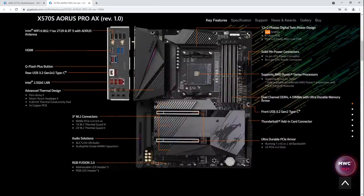Here we have the board. VRM upgrade — the old Pro AX. I think this happened on a previous revision already because I believe International Rectifier discontinued the IR3553 40-amp power stages a while ago. Anyway, this is now up to 60-amp power stages, so the VRM on this board is more powerful than it's ever been. They've also upgraded the heatsink — there's more fins. Of course, you have no fan in the chipset heatsink. Three M.2 slots, all PCIe 4.0 because of the X570 chipset. Solid-looking rear I/O, Wi-Fi 6, and now two and a half gig LAN — the older version was one gig.